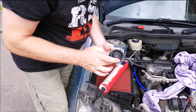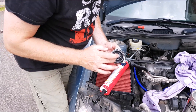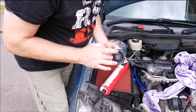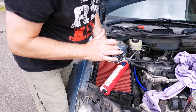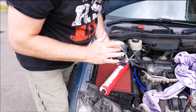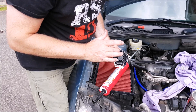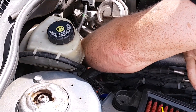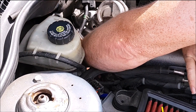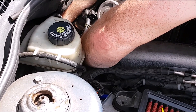Be careful not to get any sealer into the middle. As an alternative to using sealer, you could cut some gasket paper into a gasket to go around here, using something like 1mm thick gasket paper. Very carefully make the valve back up to the turbocharger, finger-start the three 10mm bolts, and tighten them all down hand-tight with a 10mm socket.